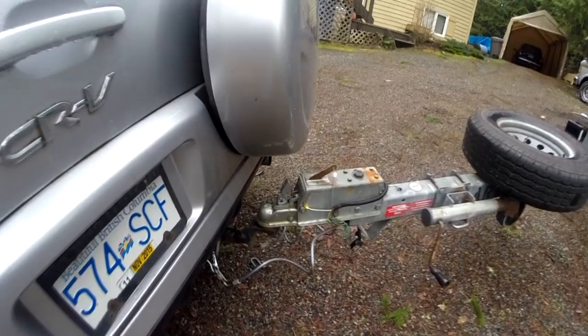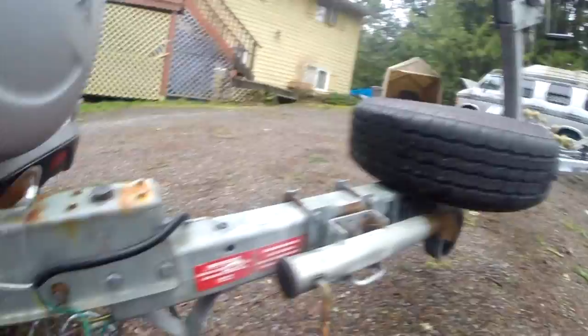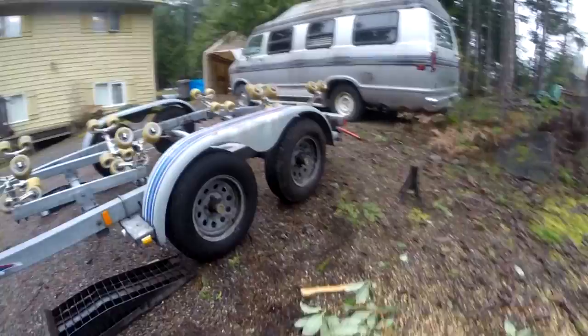So you want to know what kind of trailer you have. This is a surge trailer. It actually uses at the front when you brake — it pushes a little lever back which pretty much sets the hydraulic into motion and sets the brakes up. You can just stick a screwdriver in here. This will stop the action and will stop the brakes from going on. So make sure your brakes aren't on when you're doing this — that could be the problem right there. If you have electric brakes, make sure you disengage them before you start this procedure.